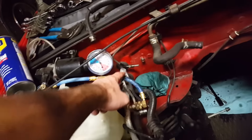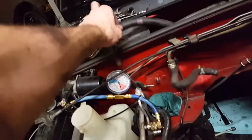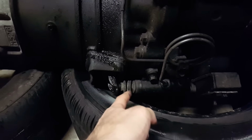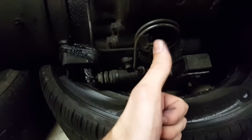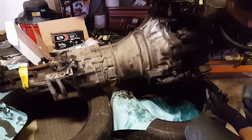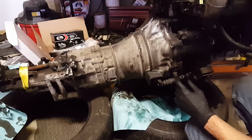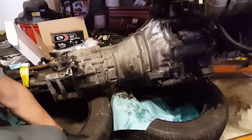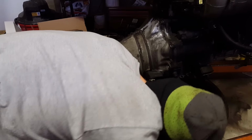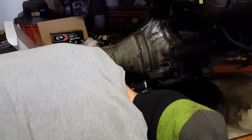I'm also gonna redo my clutch line, because it goes here, goes into this little rubber line from the master, bolts back to this stupid thing, goes through this loop-de-loop, and into your slave. Which I'm surprised the little boot isn't torn on. But, cool. Got the engine stood up, got most of the bolts out of it. I got almost to the steps to take the transmission apart from the engine. So I put the top two bolts back in just finger tight so that when I get the rest of these bolts undone, the thing isn't going to fall and kill someone.